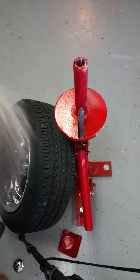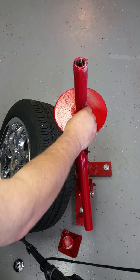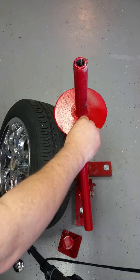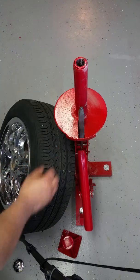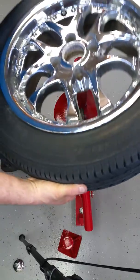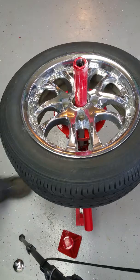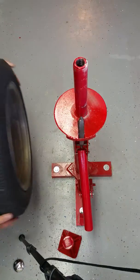So what I did is I cut that off and made this spring-loaded device that is self-centering. It's got two springs in it — one's a compression spring, one's a tension spring — to hold up against the mounting tube right here. It makes it a lot easier if you want to change a tire; it just self-centers just like that. A whole bunch easier than trying to fumble around with a tire in two hands trying to center the little pin.